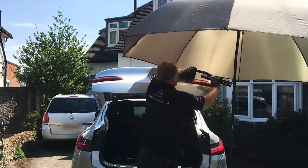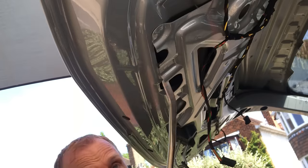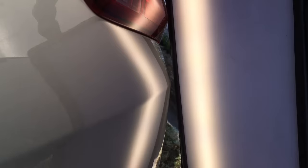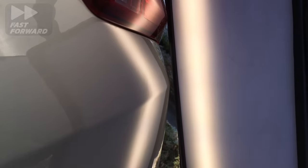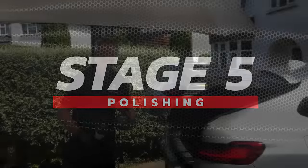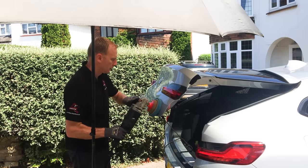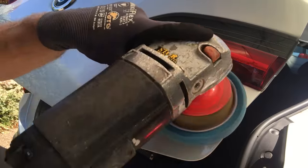Now it's time to bring up all the micro lows and tap down all the micro highs. I give the panel a gentle bit of heat and come through from the other side — again a perfect access point which is very strong to push in from. Luckily the repair has come out very cleanly, so there is minimal cleaning-up work to be done. The micro lows are super micro, so I'm pretty much just adjusting the orange peel texture in the surface of the paintwork. There aren't any surface scratches to deal with, but I give the area a good polish with a soft mop head to remove any dirt, grime, and surface marks, and to give the panel a nice glossy shine.